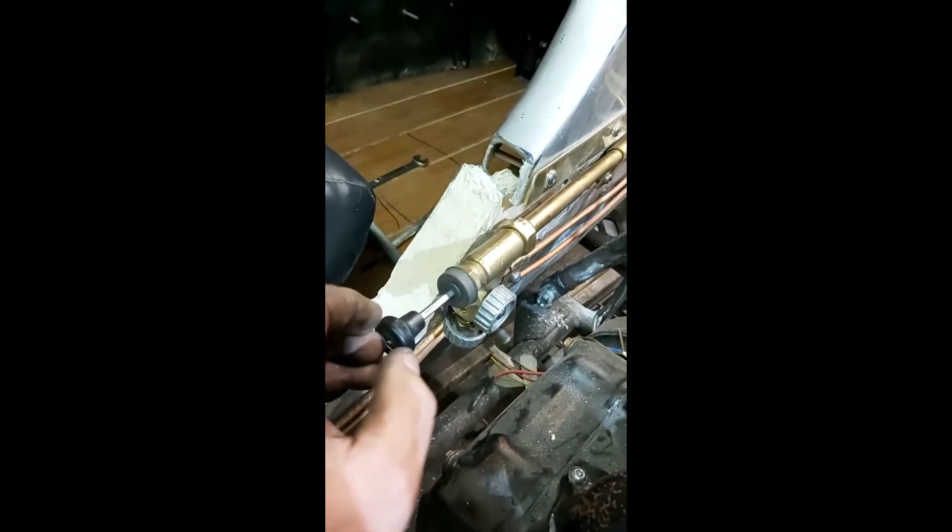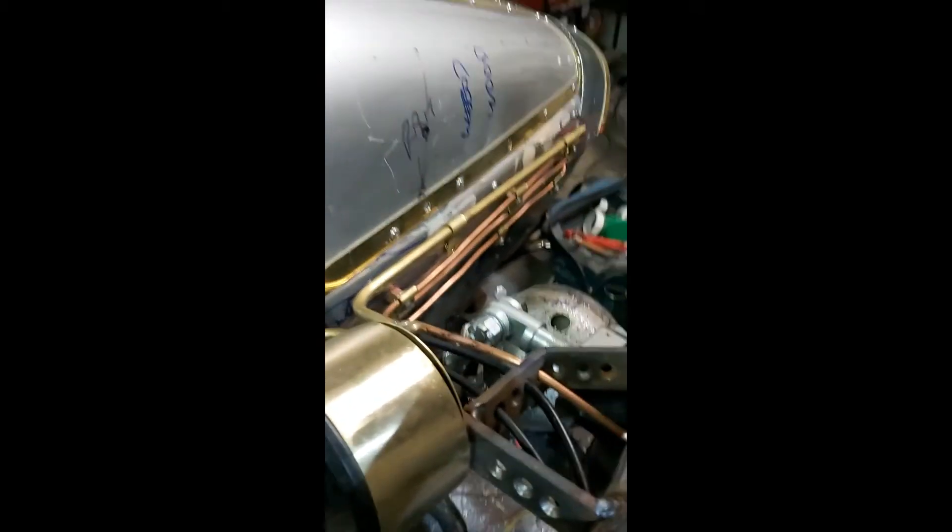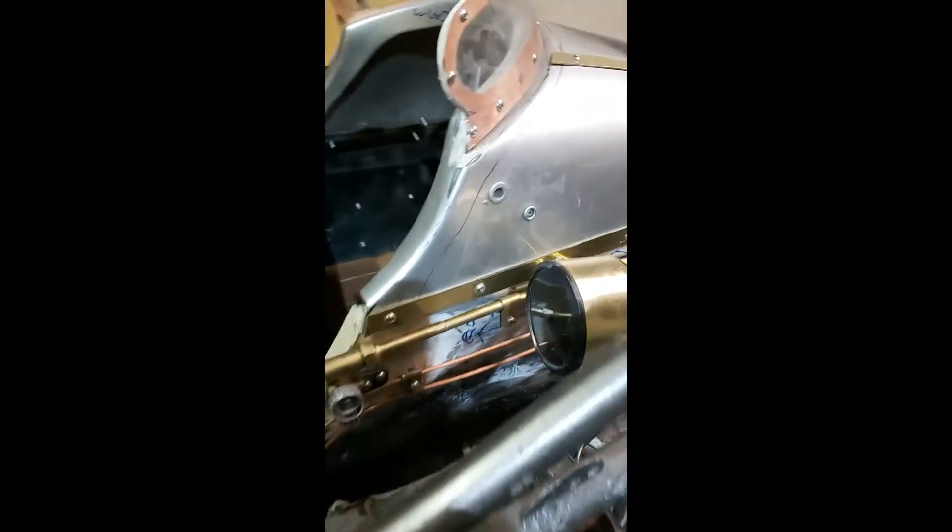That's the choke cable now fitted — as you can see, it works quite nicely. That's the remains of an oxyacetylene torch that was given to me, which I said would be a perfect job for this. I had to bore it all out and free it up, then bent it to match the throttle cable. It's fed all the way through — about six inches too long, but once the carburetors are fitted I can trim it to the proper size. That's one of the more pain-in-the-tail jobs, but it's now done.